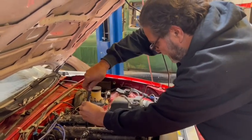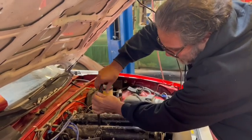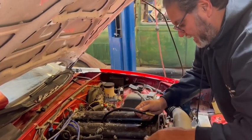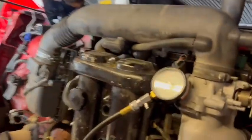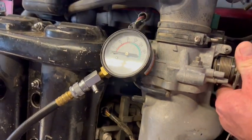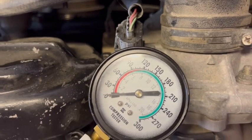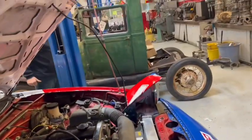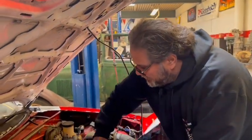Let's see what we've got on number three. I can already tell you - it's always the head whenever they overheat. I know right now it looks like it could be rings or a lot of things, but it's always the head. I already went and got a head ready to go for this car. About 20 PSI on cylinder 3.